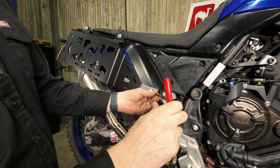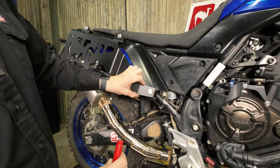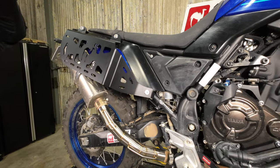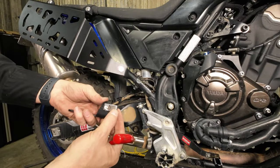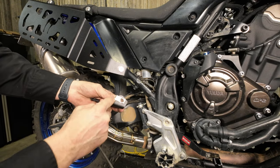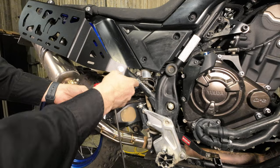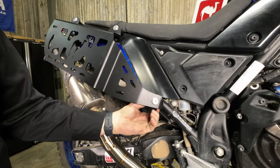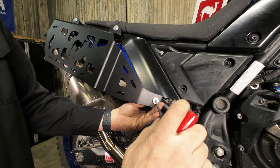Everything here is slotted — this is slotted, that's slotted, the two upper mounts are slotted. These are called speed nuts and they clip on. We want the speed nut on the right-hand side bracket to be pointed to the back, otherwise it interferes with the fit of the brake on the bracket. You can see it sticking up — push that down, put your thumb on the back of it, or when you tighten this just keep it from spinning up.